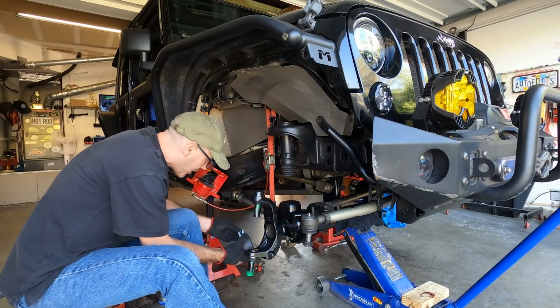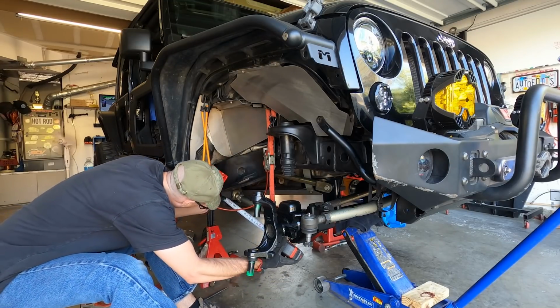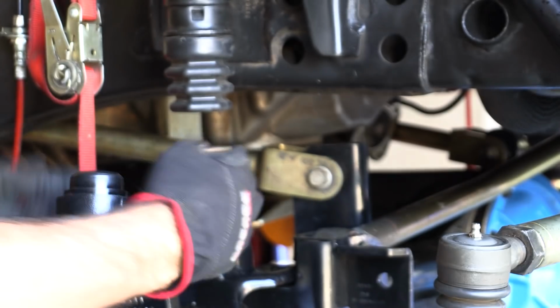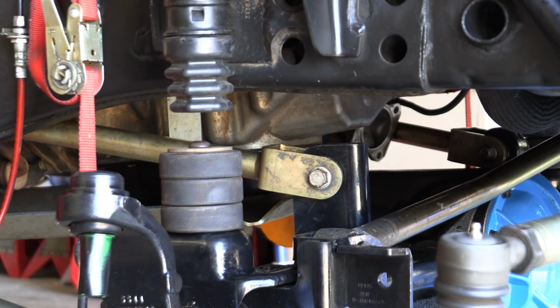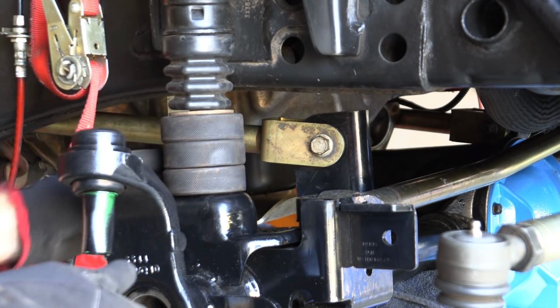And then after that, I was able to get my control arms dialed, and both lower front control arms are 23.5 inches long. I'm going to show you from this angle here. You can see the bump stop is slightly out of alignment here, but watch as we cycle through the suspension travel and we go up to bump. Now boom, bullseye for that.